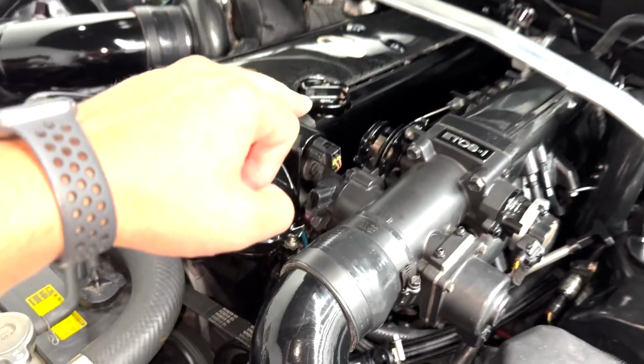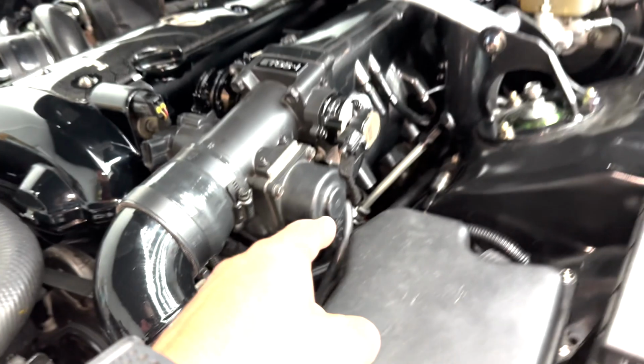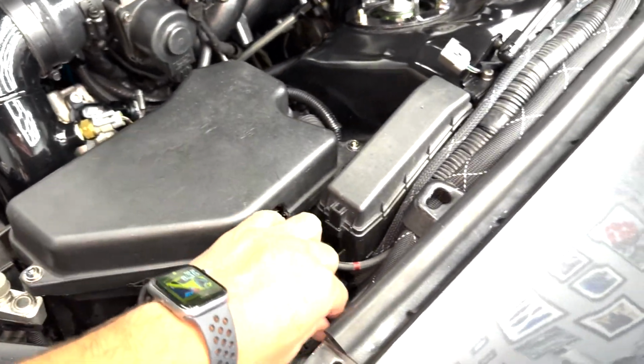Also, what I am doing is I'm going to wire the VVTi sensor directly to the ECU. So right now it's running through the OEM harness and I'm wired to the original ECU. So this is an AEM V2, and this is the original ECU. This is a DZOD Motorsports jumper kit that I've used. It's an old system, probably 10 years old by now, but it works. And honestly, with tuning, my tuner knows a lot about this stuff on the AEM V2 side of things. So Lawrence Shipman is gonna run through it and make sure she's happy, and he can do a lot of things like boost by gear with it. Honestly, the system works, so I'm gonna keep with it and keep learning with it. I'm very happy with it.